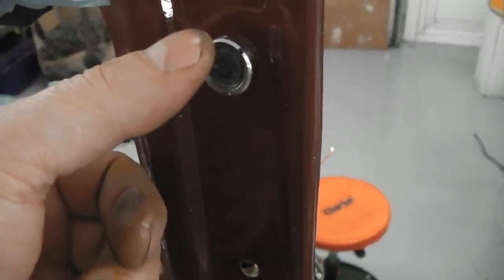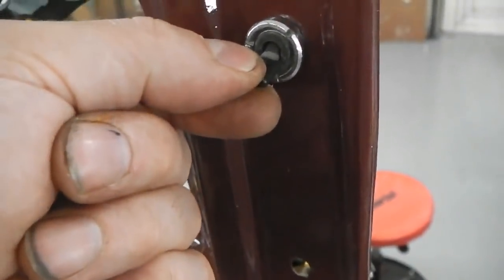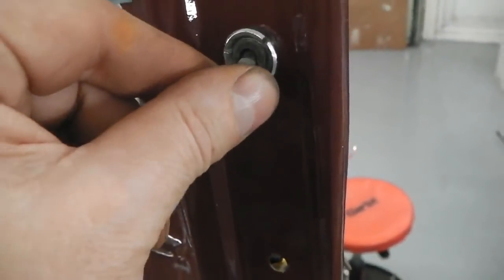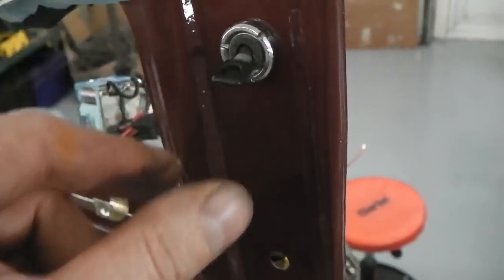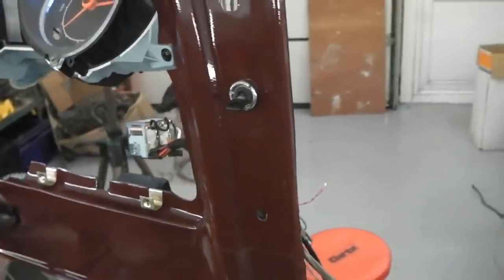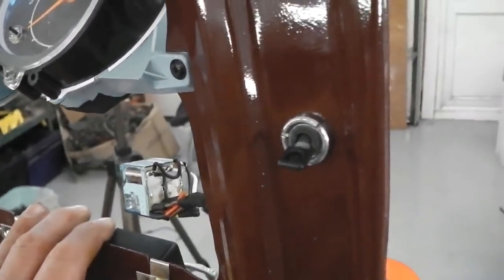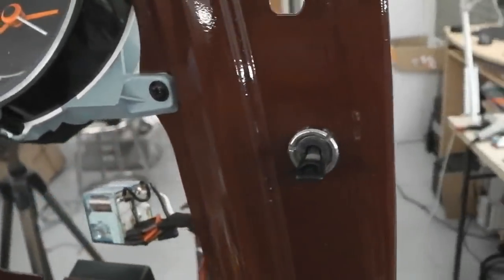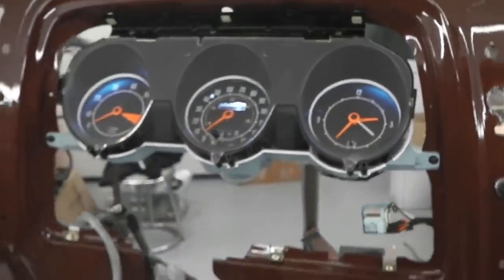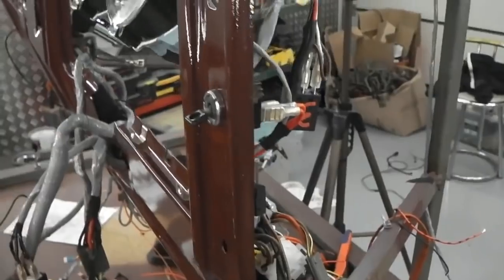That's it. I think that this switch here needs cleaning, because look, it needs to be in just the right position. So we've got mucky contact in that switch. It's probably because it's not drawing a huge current, and that's why it's not arcing across, because there won't be a lot of current draw on that little 555 timing circuit, which can't spark this into life. But switch cleaner in there will do it fine. I thought my red power lead wasn't pushed all the way in, which it wasn't quite, but it wasn't that, it was actually the switch.